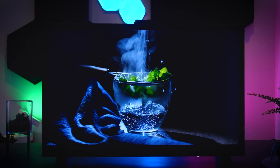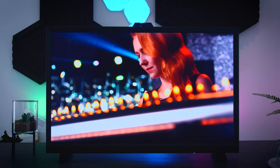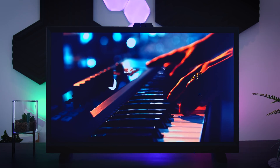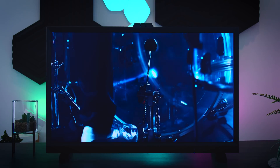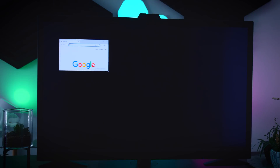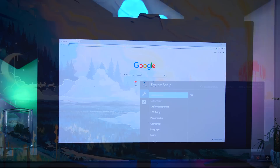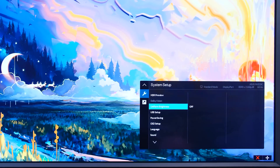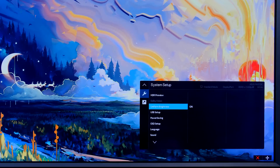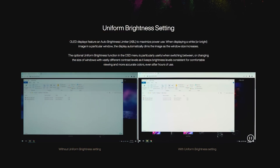Now let's check that RGB OLED panel. In SDR mode, the brightness hits 559 nits, which is a bit more than the 500-nit claim in the spec sheet and a really good, well above average result. It is not as bright as some VA options or mini LED panels, but realistically more than most people will ever need. Since OLED panels use much more power to display a full white image than a black one, there is an automatic brightness limiter built in. It behaves a bit better than on regular OLED TVs, but it's still something you'll notice when more than half of your display shows white, which can be annoying in desktop use. You can avoid it by enabling the uniform brightness setting in the OSD, but that limits maximum brightness to 300 nits. It does help fix the problem, but there is a clear downside that the marketing team just didn't think to mention on their product page, so do keep that in mind.